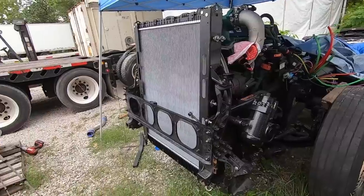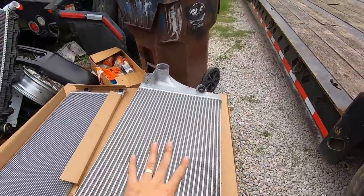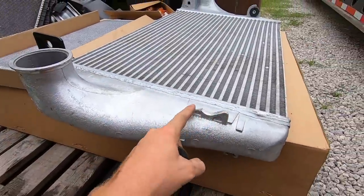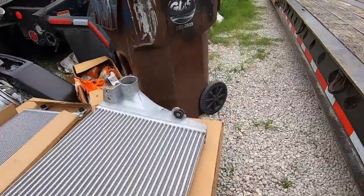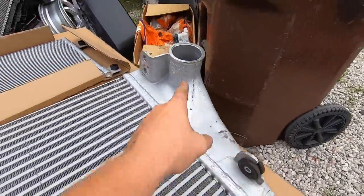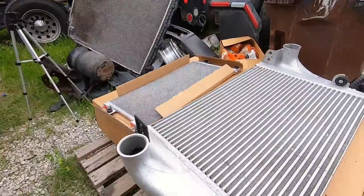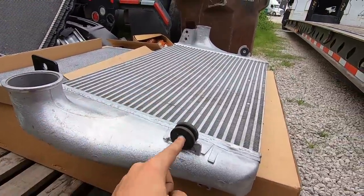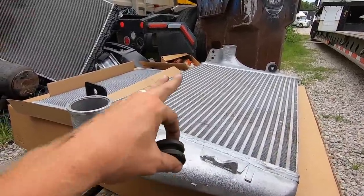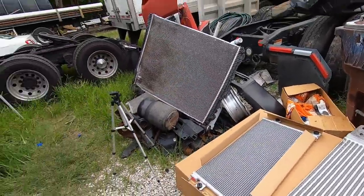It's coming together pretty well. I'm going to go ahead and start installing this intercooler that I warped back into shape. This is the bracket that I was telling you guys about that's broken — it broke right here, and this is how it's supposed to be. But it's okay. There are two bolts on top right here and two bolts on top right there. I'm just going to put this on and bolt it down — it's not going to have any effect on the actual stability of the intercooler. I'm going to go ahead and install this and then install the condenser.